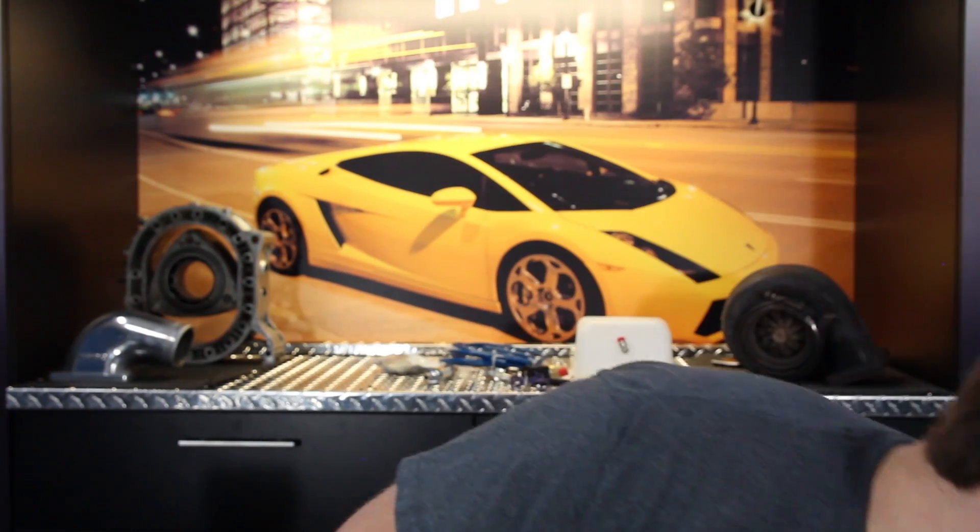That's one thing — its guardian angel ability. The second thing that water injection does is actually clean the inside of the combustion chamber. You're probably thinking: why is that important? Well, take your finger, put it inside the exhaust pipe at the very end of your car. Carbon buildup. On race cars it's worse because you don't have a catalytic converter, you don't have filters — you're just going all out. That carbon comes from a lot of things: bad gas, running too much fuel, not enough fuel — just a lot of scenarios that create carbon inside the combustion chamber.